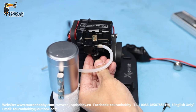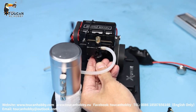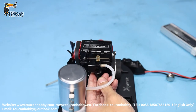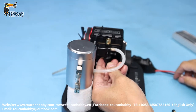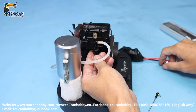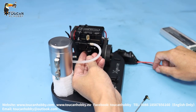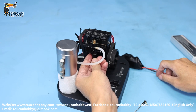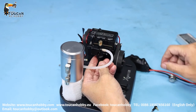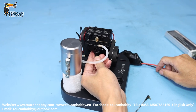Have to open a little bit. If we close too much, air and oil mix not enough, it will stop. This one I haven't adjusted perfectly because sometimes it will stop, and if the running speed goes up too fast it will also stop. So you have to do more adjustments slowly. The inside carburetor maybe needs cleaning because it's almost fully closed, and the needle may need to be adjusted — open it and check one by one.